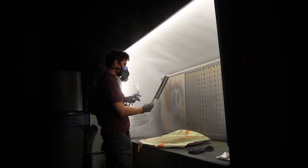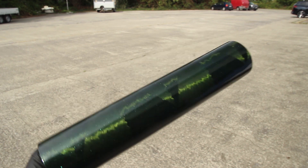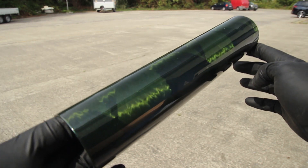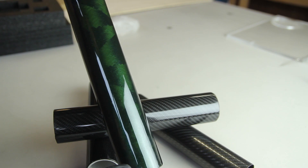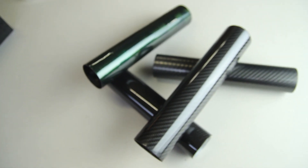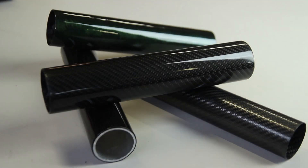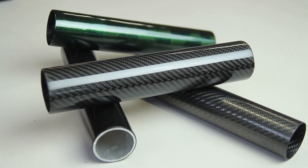I added two layers of clear, then added some green tinting pigments to get a greenish candy color on the carbon fiber. You can also add metallic flakes into your paint. The layer sequence would be: two layers of clear coat, then two more layers with green pigment added to the clear, then finish with two final layers of clear — and optionally add metallic flakes. Here are the results of the four different finishes. I hope you liked this video — more videos are coming. Let me know in the comments which finish you prefer: the green tint, the clear carbon fiber, or the polished one. Don't forget to subscribe and leave a like. Thanks for watching!